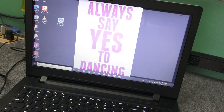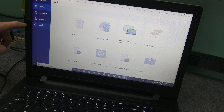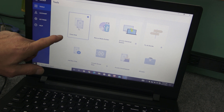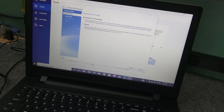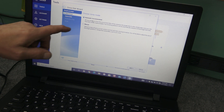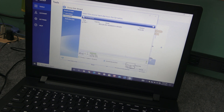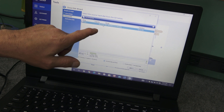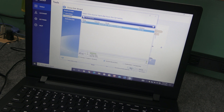Same thing if you have a Western Digital or Kingston drive — they have their own versions. Samsung has their own proprietary cloning software that works pretty well for Samsung SSDs. Click on Tools, then Clone Disk. We're going to choose the automatic recommended method and hit Next, since I'm going 500 to 500 — no special partition work needed. Our source drive is the currently installed Western Digital 500GB mechanical hard drive; just choose it and click Next.